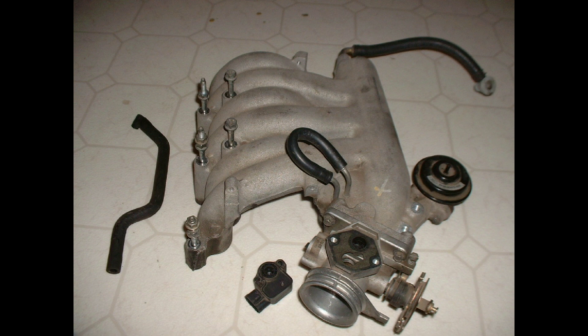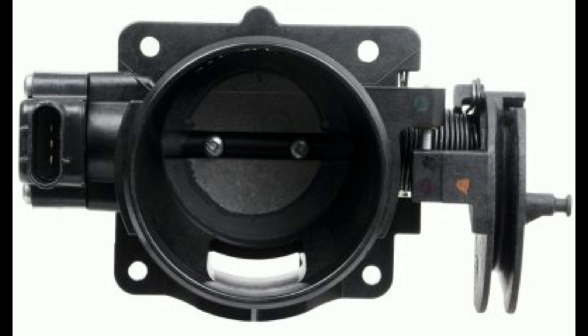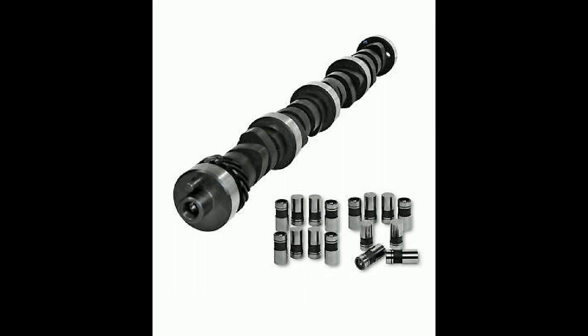We are fortunate enough to have a very reliable and capable oiling system, and we can make some improvements. Thoroughly scrub every last millimeter of the engine. Full roller engine builders can experiment with reducing the oil sent to the top of the engine, using reducers in the rear oil galleys — à la small block Chevy. Use a quality aftermarket or Ford oil pump, relieve and blueprint all the flow passages, and use a small spacer between the pressure relief spring and the pump housing — experiment with size — to increase pump pressure. Remember to use a quality 1-quart filter relocation kit.